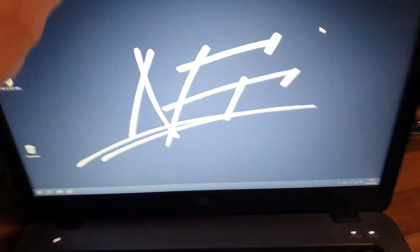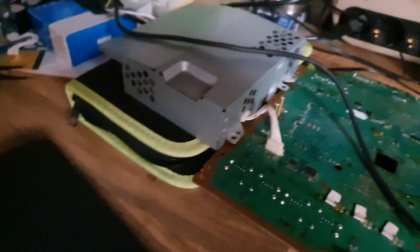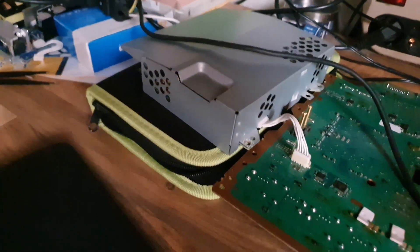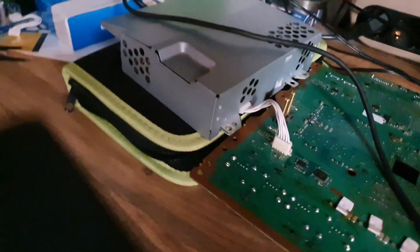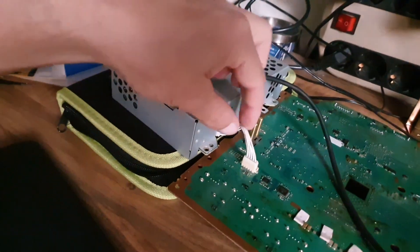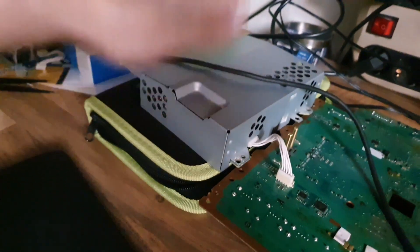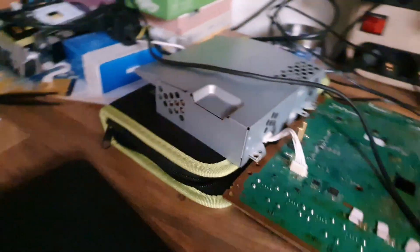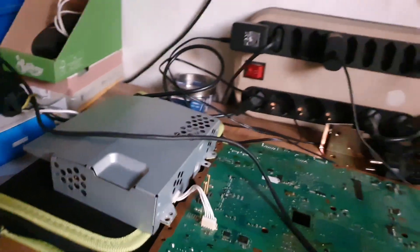Important: before you start, first connect your laptop or computer to the adapter cable, and then turn on the PlayStation. Also, you only need the power supply connected with the 5V standby cable — you don't need to reconnect all the power supply cables to the motherboard. I proved this two or three years ago: for the Slim editions as well, just the power supply with the 5V line cable is all you need.